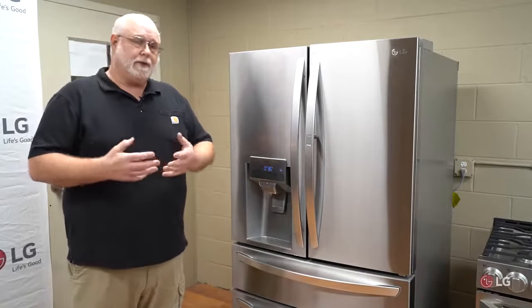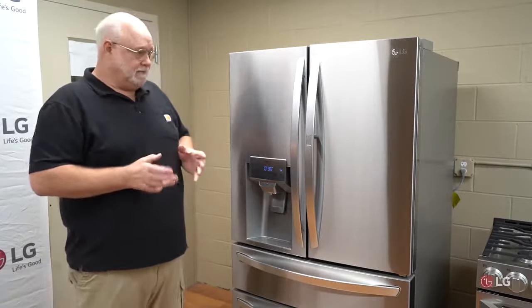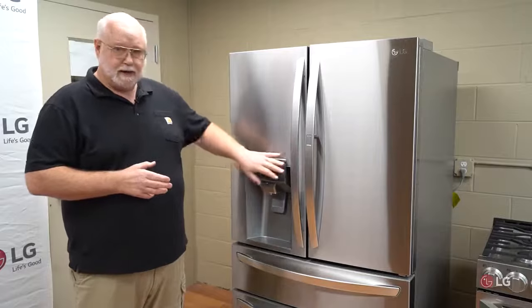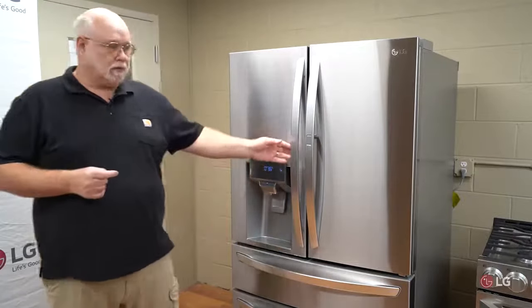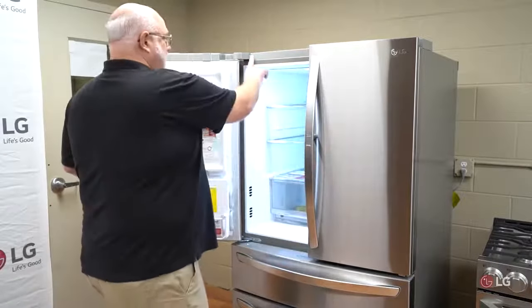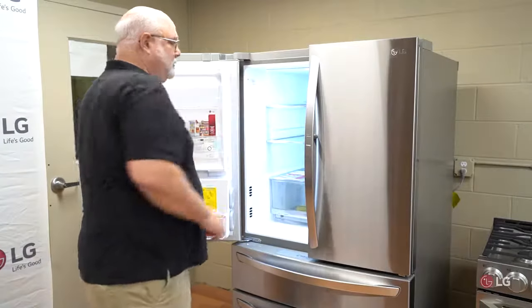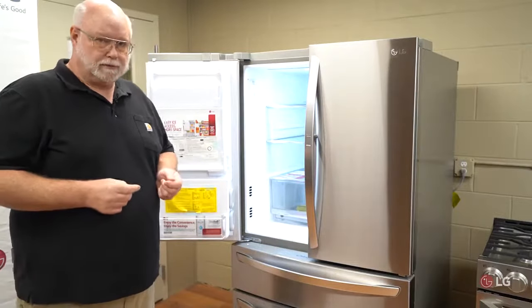Another thing to ask: is it a brand new install? If so, does your display work correctly? On older units, they had push buttons on the door frame. On newer units, they use what's called a reed switch — a magnetically controlled switch that detects whether the door is open or closed.